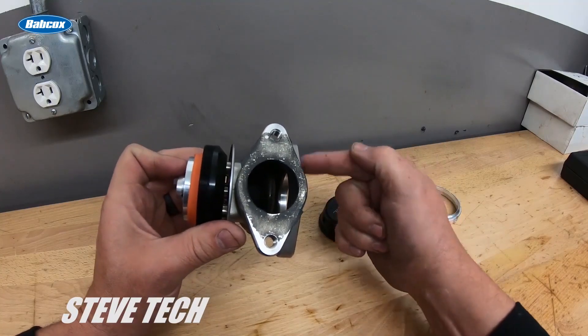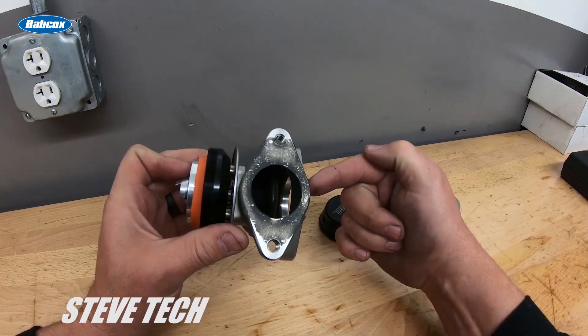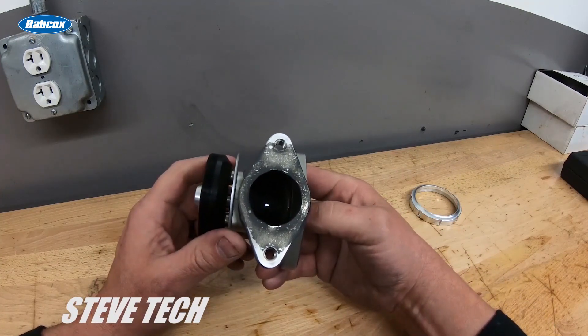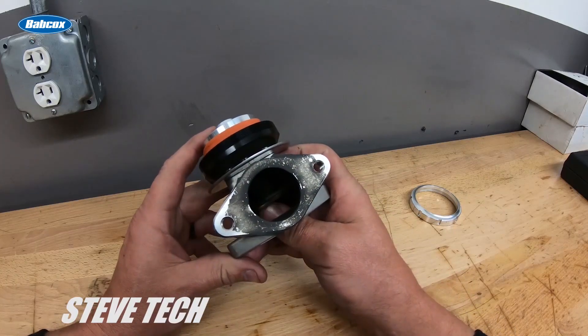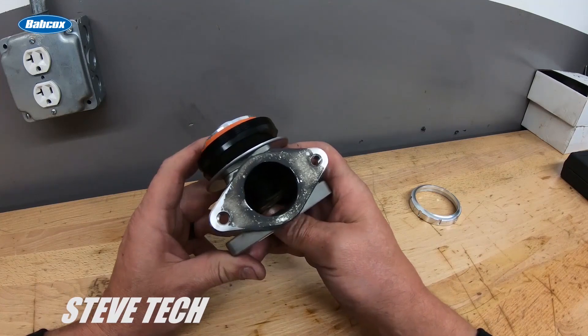This is key — I'll cover how this works when you try doing this with a ProCharger either in this episode or the next one. Opening the wastegate allows exhaust gas to exit through here instead of forcing everything through the exhaust turbine wheel, thereby slowing down the turbocharger.